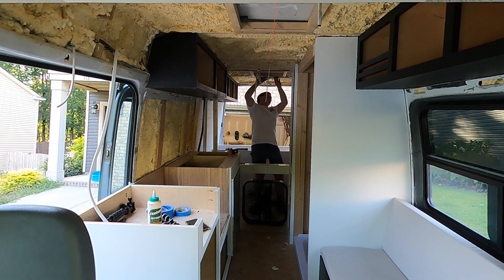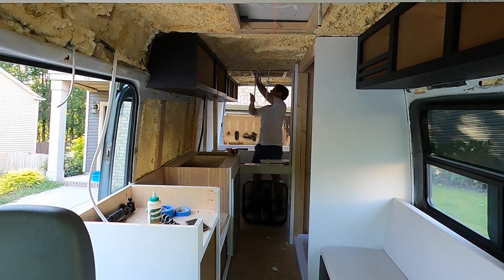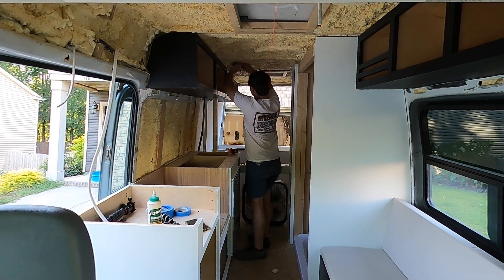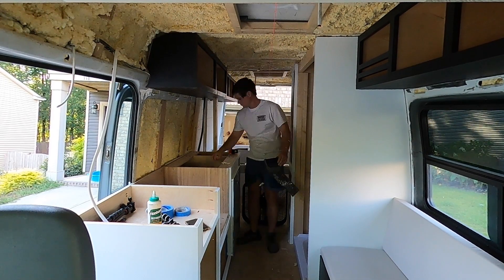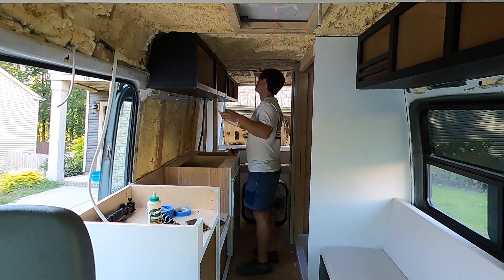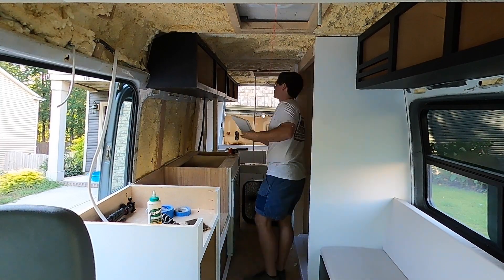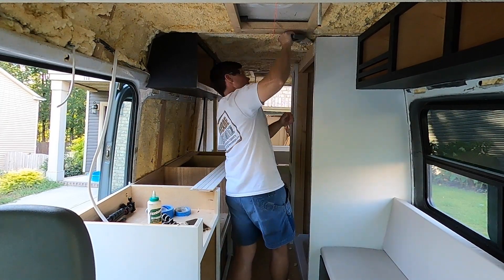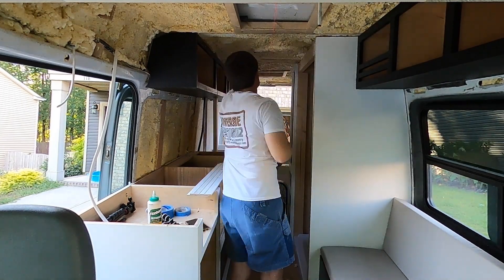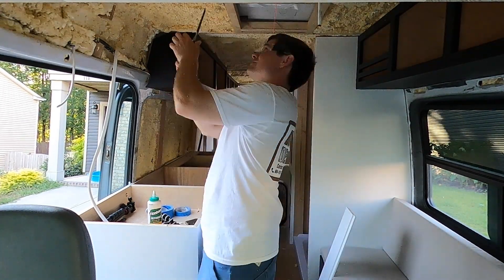The next thing we had to do was go through the van everywhere and make sure all of our spray foam insulation was trimmed down. With spray foam insulation it's almost impossible to get it to lay down to a uniform thickness — you spray and let it build up, and it almost always expands past where you want it. That's actually what you're looking for: you want it to expand past and then cut it back smooth. We're not professionals; we didn't get a perfect coat, but it definitely helps with the temperature and we would do spray foam again.